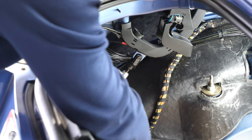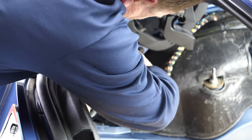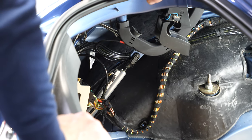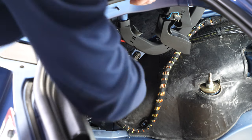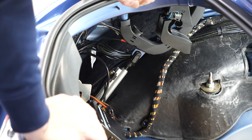Next we'll put the controller back into place. The harness goes in only one way. We want to attach the power cable to the pump. We could bolt down the controller already, but since we just changed all cylinders in this top, there will be a bunch of air coming back into the reservoir, so there's really no use bolting the controller down yet — we need to refill the pump after we've cycled the top a little bit.